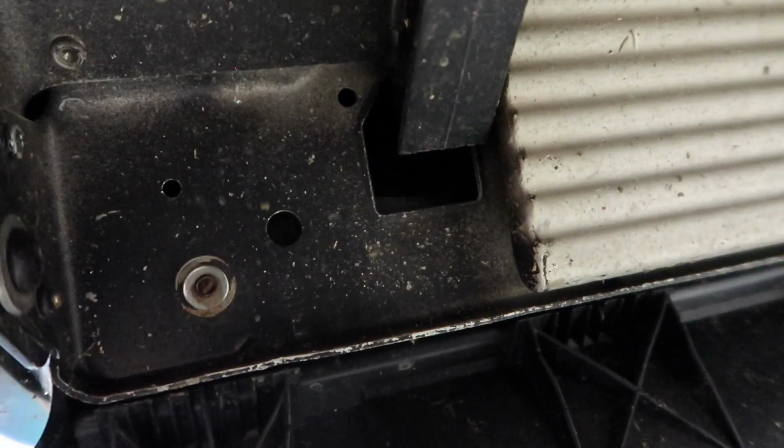But you can see this cracked across here, and the other side over here cracked too. So I thought it was just mine because there was a bigger guy driving the snowmobile and the suspension wasn't tuned up. He never had the shocks rebuilt and it was pushed down, and I thought it was from the snow flap dragging and it broke it, which is probably right. But this other snowmobile we got here hasn't been repaired yet. It doesn't need to be yet, but you can see underneath it, this is what it looks like factory.